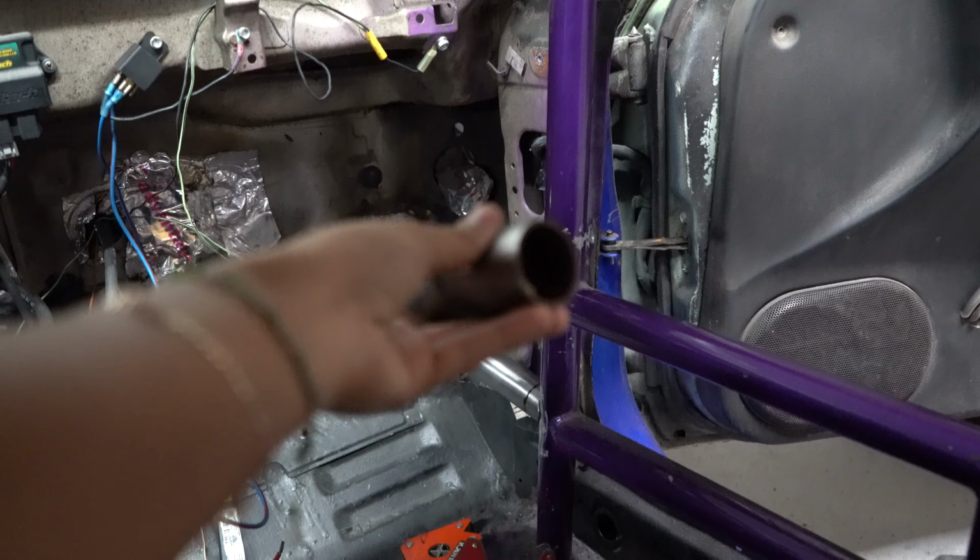There's Josh. And then a very important thing that this car was doing, the lines on the wastegate would pop off all the time, and so would the vacuum lines to the ECU. So they changed it to AN lines, right? They're all AN, or are they something different? They're still silicone, but it's high grade covered temp. And we rewrapped the downpipe where the silicone is melting to the boost reference. Because whenever Camel would drive, he'd be over boosting the car, and we've had this problem almost every single event we've ever been to. It happened at 4th of July. It happened at the Monster, a demolition derby that we did in the last video. It's one of those things, it's happened a lot. And we can't have that happen in the middle of competition, so that's one of the things that got fixed.